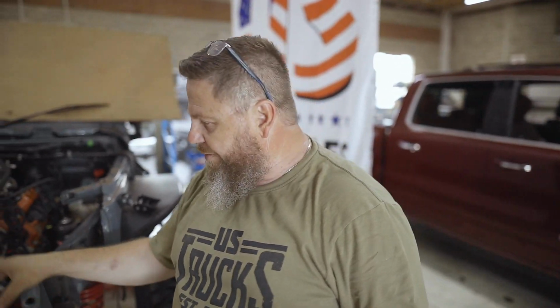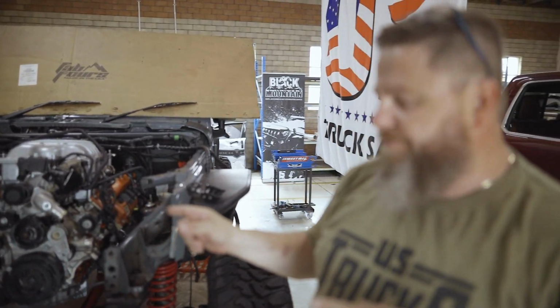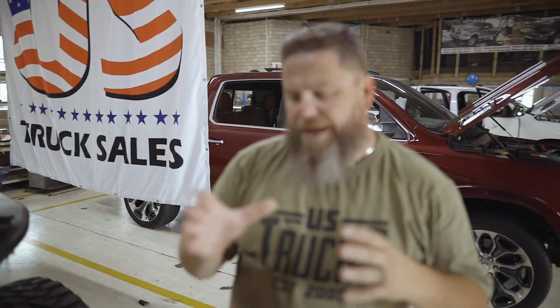Okay, so we're still sitting with the issue of the steering box that's fouling with the alternator over there, and we've obviously now moved the cross member out. We've removed it, and we need to put the other one in. But the problem is, we're still fouling with the steering shaft and the alternator and the piping for the new steering box. So that's going to be an issue, and we're just trying to find the ideal position. The one that we did before, the engine was in a different position because of various other reasons, different gearbox having been used, etc. So this one we hopefully will have more space to work with, so we'll keep you informed.